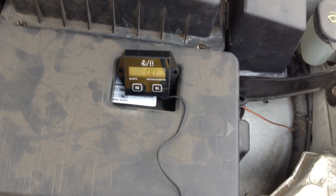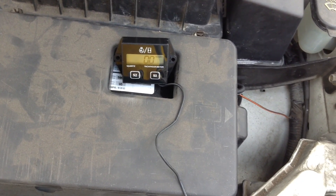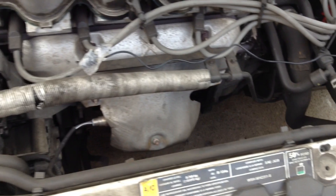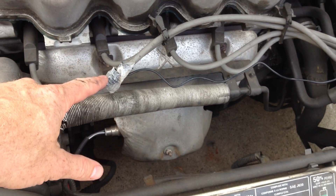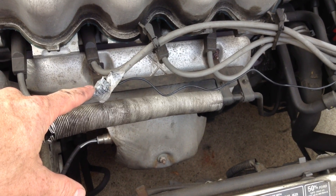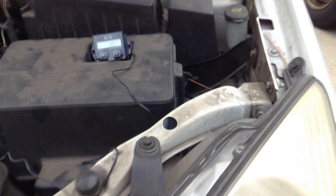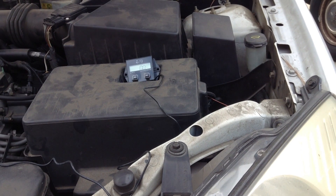Here's the setup. I put the hour meter over here in a place where it's not going to get sucked into the engine. You want to run the wires away from any spinning belts. I just wrapped the end of it around the spark plug wire maybe 10 times and then taped it in place with duct tape. Let's see what the meter reads when I rev it up.